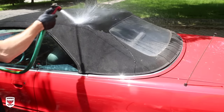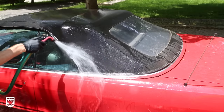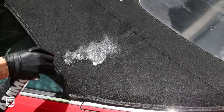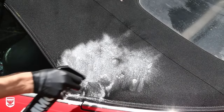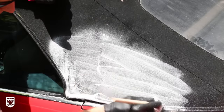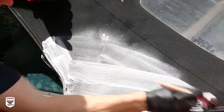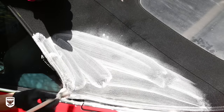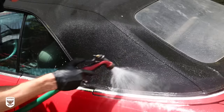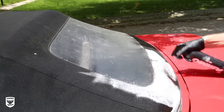After identifying the material, step number two is to heavily rinse the cloth top with water. If you decide to use a power washer, be sure to keep the nozzle head a safe distance away from the material. This removes about 80 percent of the trapped contaminants before step number three. Next, apply Ammo Shag Fabric Cleaner to one small section at a time. Immediately agitate the cleaning solution with the Ammo Interior Brush, moving the brush in straight lines — horizontal and/or vertical. Tamp the bristles along the crease, edge, or stitching to help release the embedded dirt. Then rinse the area to flush out the newly released dirt before it dries in place again. Repeat the process in small areas and work your way around the car — a thorough cleaning should take about 15 to 20 minutes at most.